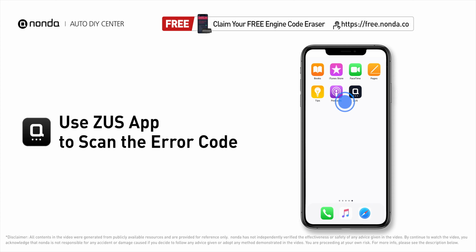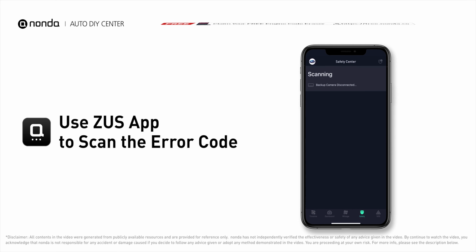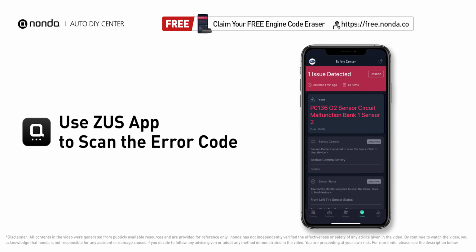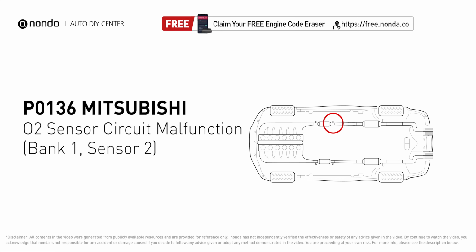Use the Zeus app to scan your vehicle and see the error code P0136. It indicates the downstream oxygen sensor for bank 1 fails to meet the minimum and maximum voltage limits calibrated for the ECM to see.